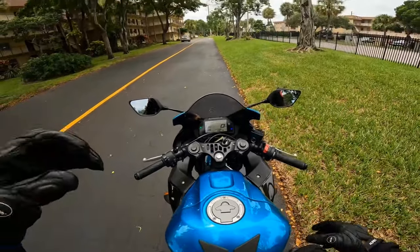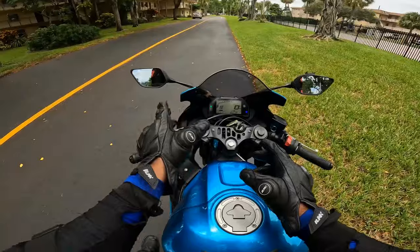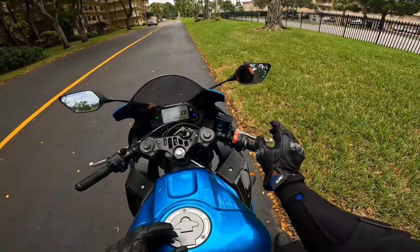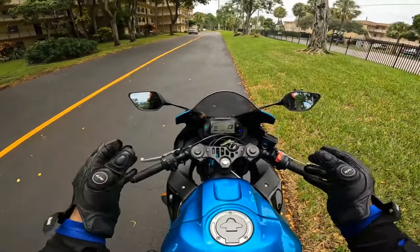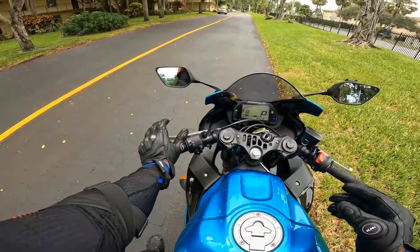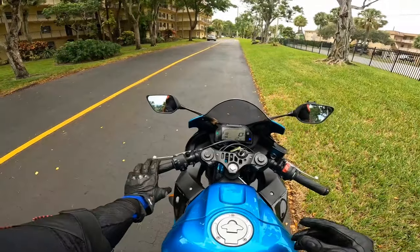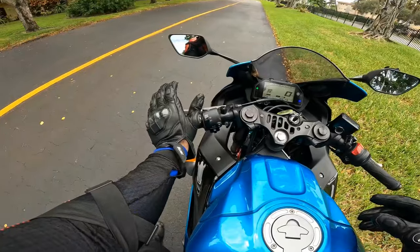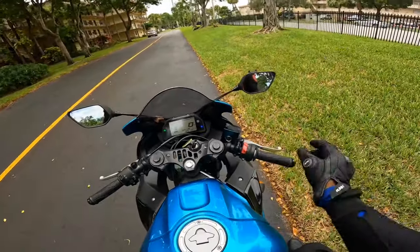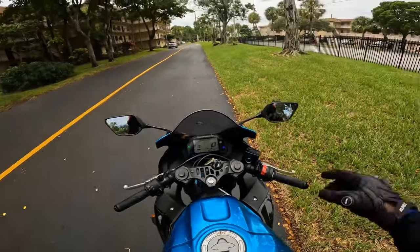So I showed you two demonstrations of what I like to do when I'm counter steering. For me to go to the left, I'm just going to push to the left. For me to go to the right, all I'm going to do is push to the right. When I'm going around curves, I like the pushing effect, because you can slowly get on and you can push hard or not too hard to know how much curving you need to go around a specific curve. So if your curve is long, you're going to be slowly pushing in until you come out of the curve on the other side. Same with the right. If it's a real long curve, you keep pushing and holding steady until you come out the other side.